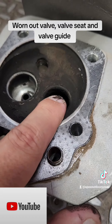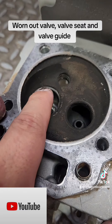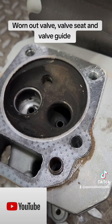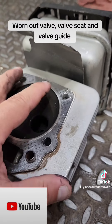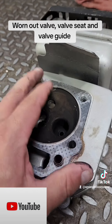You can see this valve here is getting blow-by. This valve here is nice and clean with a machine face, and you can see this one's all full of carbon buildup — that's usually from dirt ingestion or running super rich with a dirty air filter, causing carbon buildup on these.